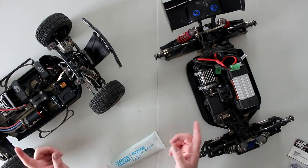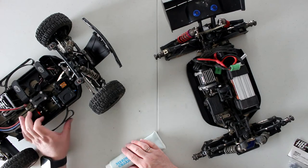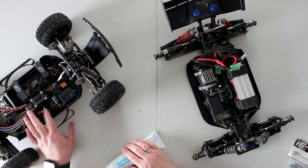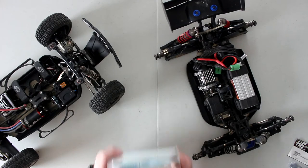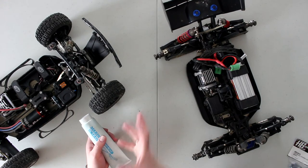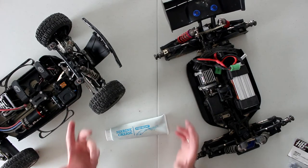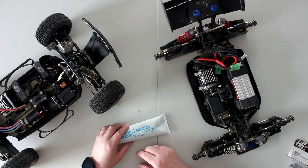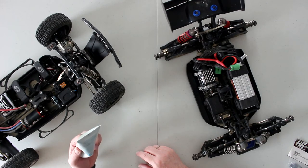That's why you just want a little bit of grease — just to prevent the chatter of your diffs. Do not overfill that case; it might even create more issues. Like I was saying, the grease will expand with heat and these cases are not fully sealed — dirt will go in, water will go in. That's why I use marine grease: if you play a little bit in water it will repel and wash it away.